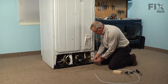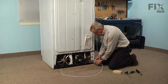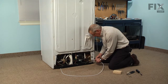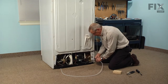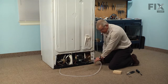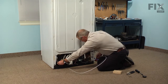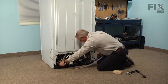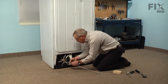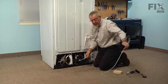We'll slide one end into one end of the tubing. We'll take the new tubing, slide it onto the other end, and then we'll tape the two pieces together with a little bit of electrical tape. The metal screw just provides a little support at that joint so that it doesn't flex. Now we can feed that tubing through. We'll pull on one side and push on the other until we've pulled it through, and we'll unravel our tape. Now we can discard the old tubing.